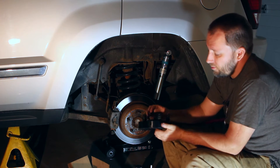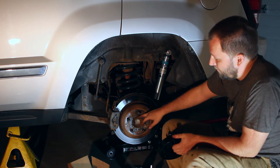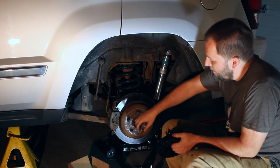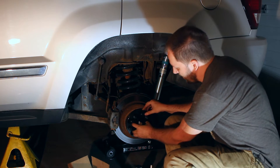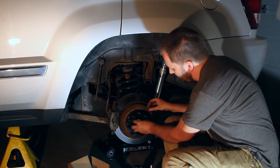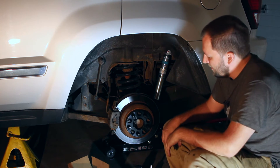The other reason is that people don't buy the hub-centric ones. This one is hub-centric — you can see there's a hub-centric ring right here. The actual weight of the vehicle will mostly sit right on that, and that's going to make sure that it's centered.